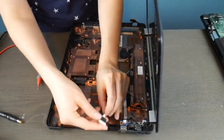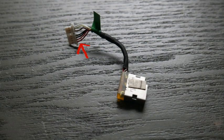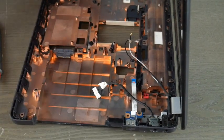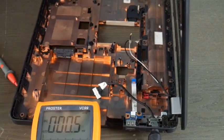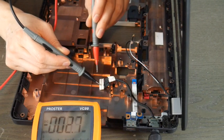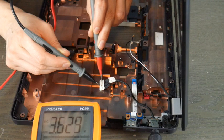This is separate, and it's the same with every model — I just have this HP in the shop. If you peel back the tape, there are red and black wires. We're going to use the red lead on the red wire and the black on the black. Make sure they don't touch, so you get an accurate read. When working with power, you should always be careful. I'll plug it in — red prong to red wire, black to black — and this gives me a readout of 18.9 volts, confirming this is a working power jack, well within the acceptable range for this computer.